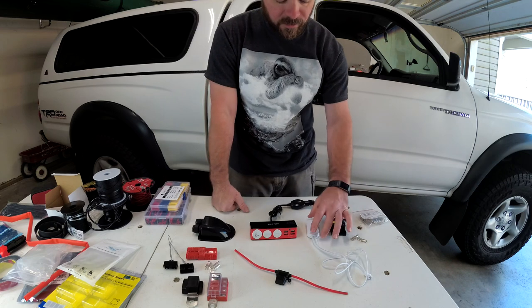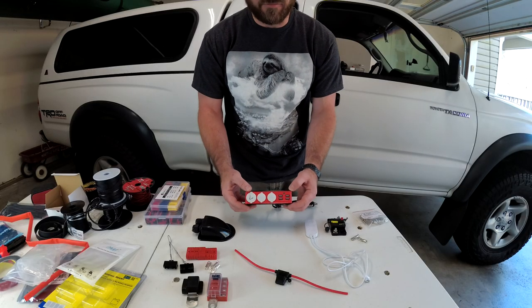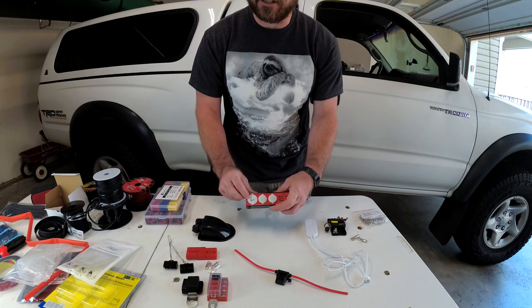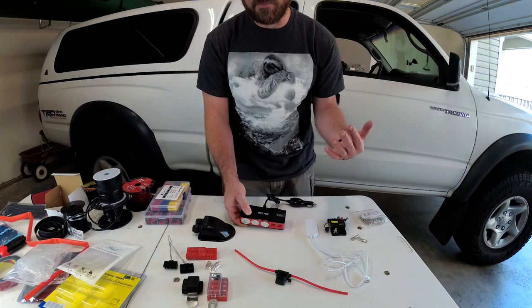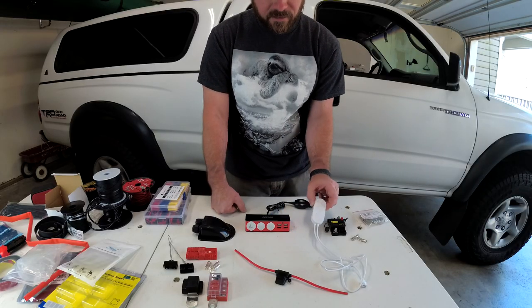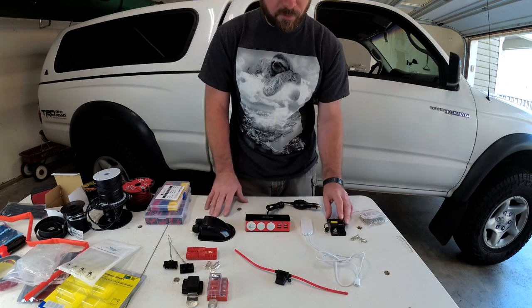When I go up in the tent and want to turn things on, I flip this on. This is wired directly to the LED strip controller, which controls LED lighting around the inside of the top of the tent. It's also wired to a power distribution unit that has four USB charging ports and three regular 12 volt sockets. It has a little LED readout of your battery voltage, which is nice to see how the auxiliary battery is doing. These LED controllers tend to pull a little juice even when the lights are off, so it'll be handy to be able to switch this off separately.